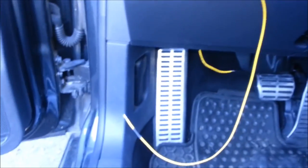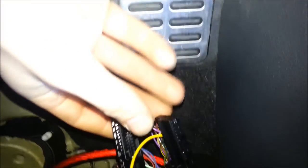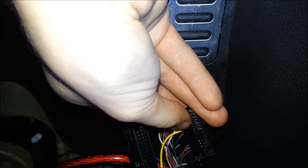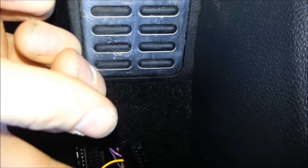For the parking light wire: after you split the connector you can see right here that it goes between the purple and the black-yellow, and that is slot number 19. Now we're going to put this connector back together — just slide the two halves back and click the casing back on — then re-seat it and test our parking lights.